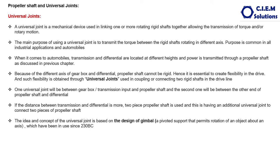Universal joints are really very strong in transmitting high torque. At the same time, they have certain limitations in transmitting torque in terms of velocity and angle — beyond certain velocity and angle, universal joints will not work. To overcome this, constant velocity joints, that is CV joints, were invented, which are used in front-wheel drive vehicles as discussed in previous videos. Review the notes provided, and in case you have any queries or doubts, you can contact me through email.